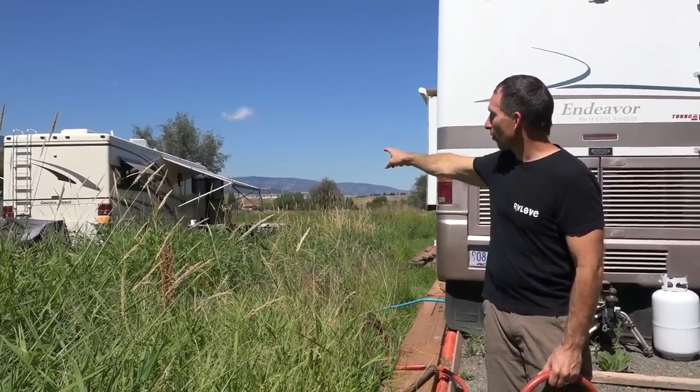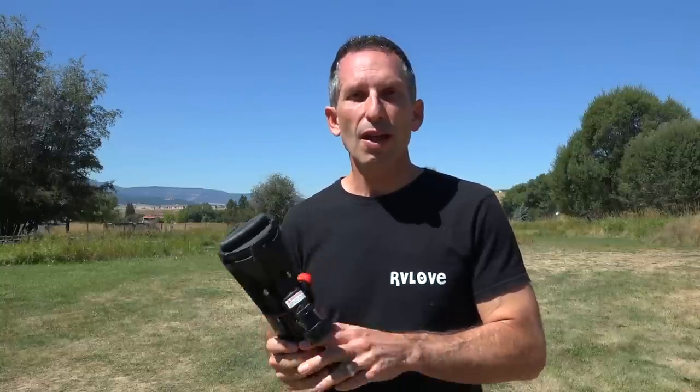I was actually really impressed because it exceeded what I had expected. The instructions mention that you should not let the pump run dry for more than 30 seconds, and you should not let the pump run for more than 15 minutes total because it could overheat. I was able to empty our black tank in under 5 minutes, then let it rest for a minute or two, and followed it up with the gray tank. If you have an ability to hook up fresh water as well, you could then flush the tanks and run it again to clear out the lines really effectively.